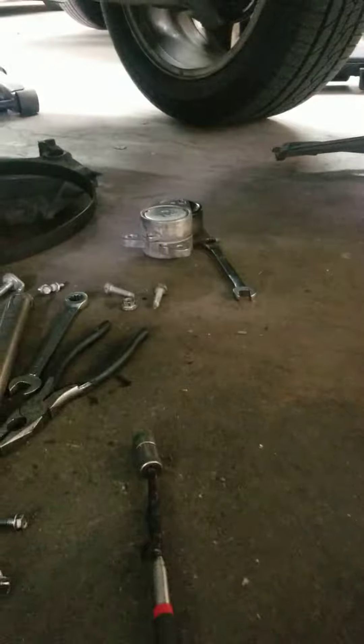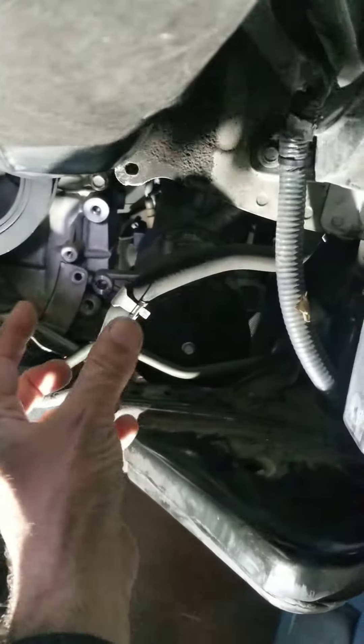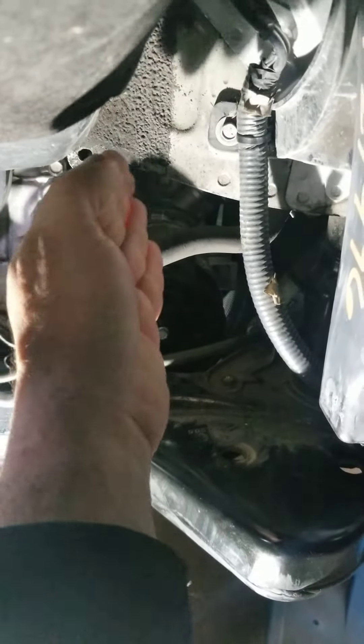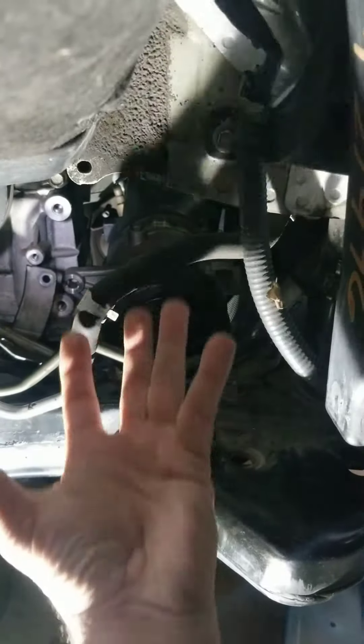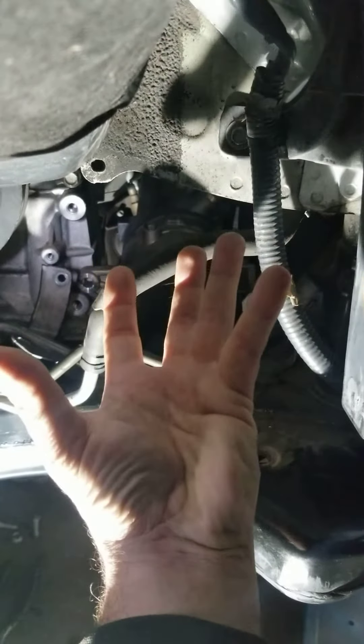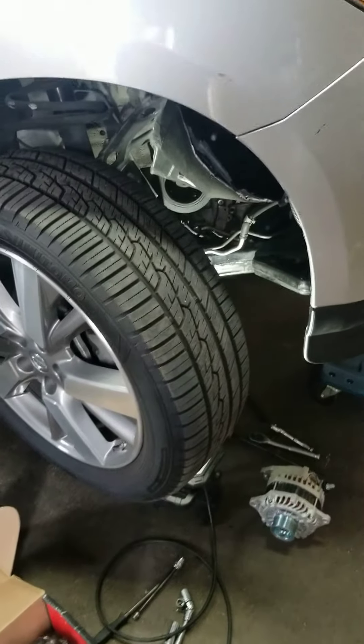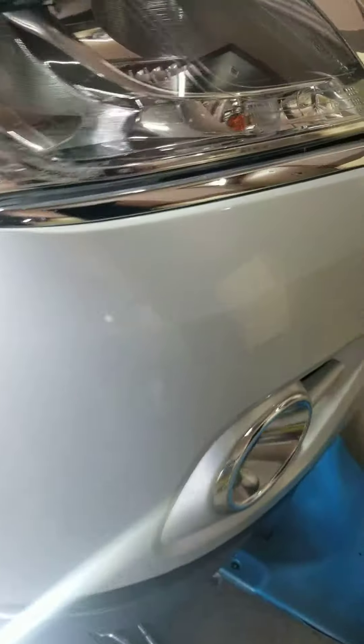The tensioner — you can see it over there, I already took it off. Then you send the alternator sideways out from here, put it back together, tie it up, and the compressor is gonna go all the way back up. That was all about the 2012 Nissan Pathfinder alternator replacement. Good luck guys, and God bless. Thank you for watching.